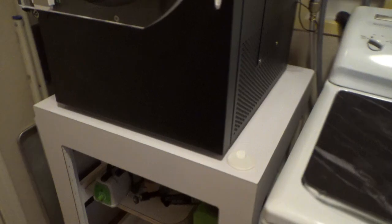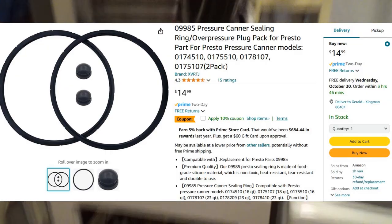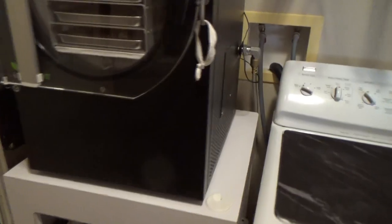It also eliminates the exposed area where your metal chamber would be, and that gathers condensation. Room air comes down and it freezes on that space there. That won't occur in this case because there's an insulator factor. So as you can see here, I do not have a towel underneath the front of my machine because there's no moisture that drips down. There's no condensation that occurs.